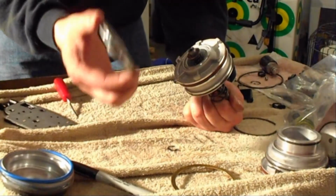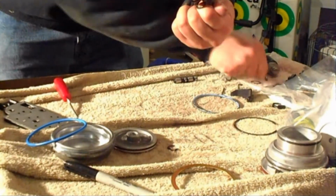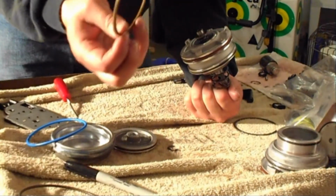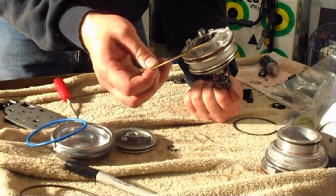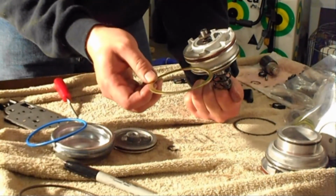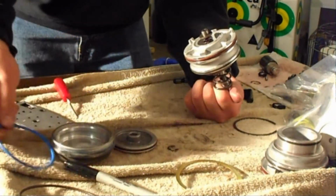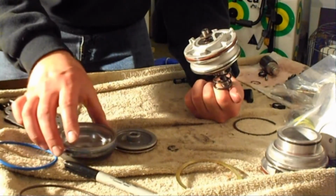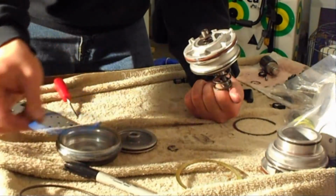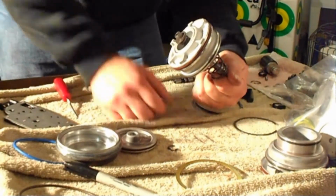Then you assemble your fourth piston and the cover. And then your retaining wire that holds the cover on. There is a gold shim in here. You pretty much gotta place it in and test some movement on your band before you decide if you're gonna keep it in there or take it out. So when you do that, do not put your O-ring on, because you have to put the assembly in, check for play. If it's okay, then you take the cover off, put the O-ring on, cover back on, snap ring, and you're good to go. So I'm gonna go ahead and finish that up now.